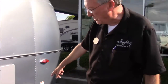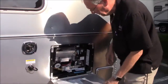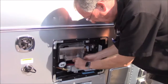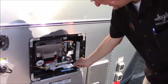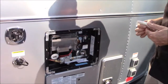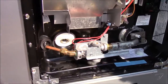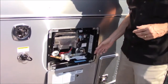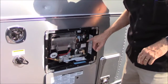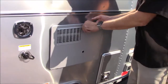Your dump station is right back here. Right now we're going to talk about the hot water heater. There's really no need for you to get in here other than service. Everything is winterized - that's why this plug is just sitting in here as you requested. It's all depressurized and has potable antifreeze in it, so you're good for the winter. If you ever need to get in here, this is a thermocouple right here - that's user replaceable. But most of the time this is just for the service guys. You don't even have to come out here to light it - it's all controlled from inside.